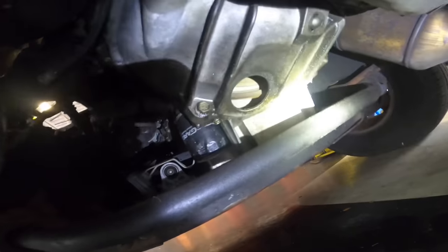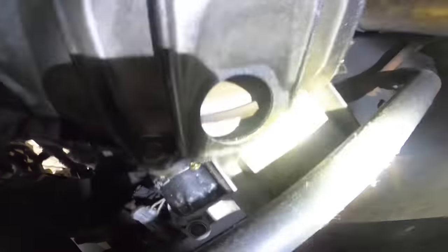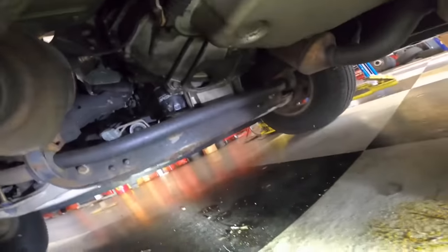Okay, someone's been down here before because the inspection cover is missing off the bottom of that transmission - we can see the flex plate spinning in there. I don't see any fluid leaks, so that leads me to believe it may have become overheated and the fluid has been escaping through the vent tube. I could be wrong, that's just speculation, but regardless it is pretty low.